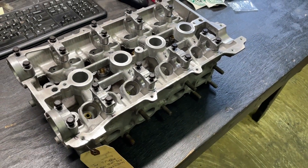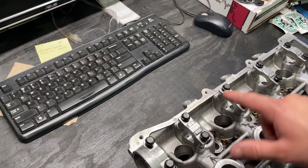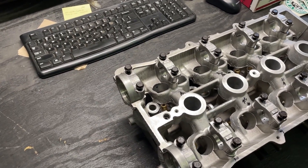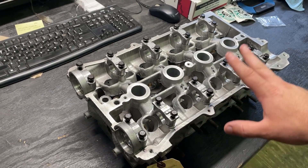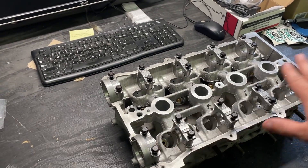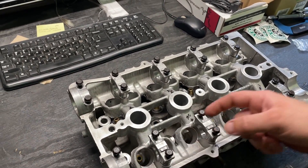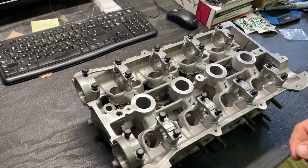It's not a lot — it's repairable. We have to cut the caps down and rebore the line. But it's off just enough because your bearing clearance for the cams is about two to three thou. So if it's one thou off in one place and one thou off in another, the cam will fit in and spin, but you're not going to have any correct bearing clearance. We're starting to think that's where our metal shavings were coming from — the camshafts eating the journals, and some of it was definitely bits of the camshaft itself ending up in the pan.